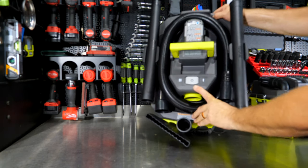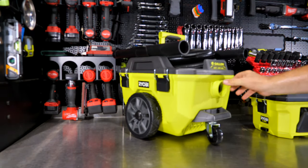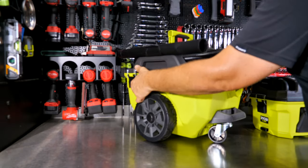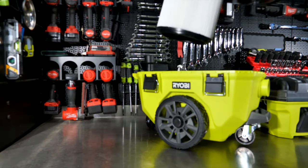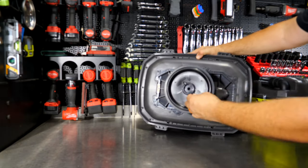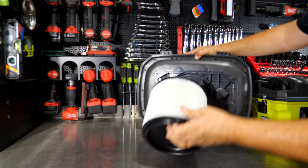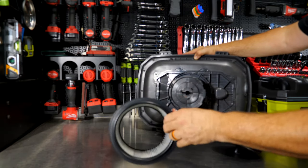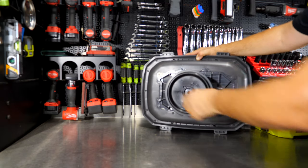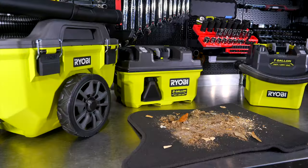Up top you get a high/low switch — not just power on/off — boosting CFM up to 80 at around 66 decibels, with up to six-gallon capacity. The six-gallon runs a much larger canister pleated filter, which is also washable and usable wet. To remove it, find the groove inside, give it about a quarter-turn, and it slides off. Pull off the cap to clean the filter, replace the cap, find the groove, quarter-turn to lock — no threading, just quarter-turn and you're locked in.